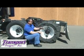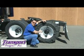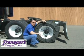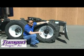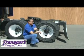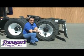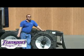and I'm gonna come down here, and I'm gonna grab it here, okay? The other thing is, when the cops see these on your truck, if chain law is up, they're gonna just wave you through. It's real easy to spot these, obviously, a lot easier than trying to see if you have iron on. So take the extra minute to go ahead and strap up your chains. It's a great safety precaution, and it'll also save you a few headaches. Okay. That's the basic process, guys.